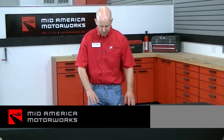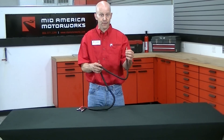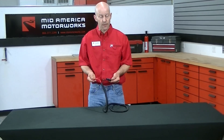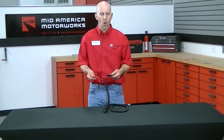For some 6th generation Corvette owners, sometimes the battery goes dead no matter what you try to do, and certainly there have been issues with that in the past. Sometimes an emergency access system is actually the best course of action if your battery ever does go dead. One like this would connect up to chassis ground with the eyelet and would also connect up to your fuse block. Even if the battery is totally dead, the clamps are down at the front of the bumper cover in an inconspicuous location. You take this, hook it up to a pair of jumper cables or another battery, and this will allow you enough power to open up the doors on either the driver or the passenger side so that you can pop the hood and charge the battery.